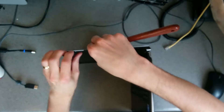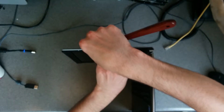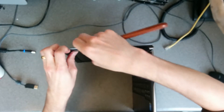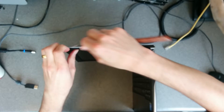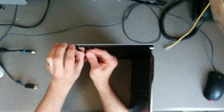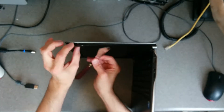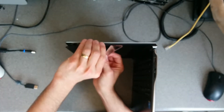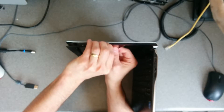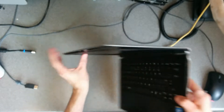It was much sturdier down the side. With that one I found it easier to slide the spudger underneath where the screen is. It's not a good idea if you've got a working screen because it'll probably scratch it, but this screen is obviously broken, so it doesn't particularly matter.